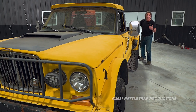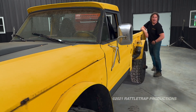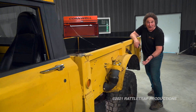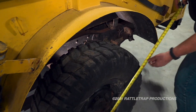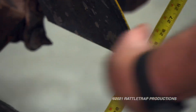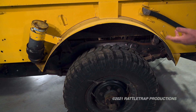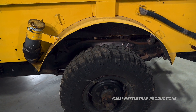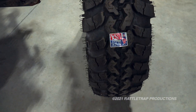The first thing you need to decide is what the goal is here — how do you want the new wheels and tires to fit? On this old crusty truck, we want to get rid of the old tall skinny look and go wider and taller to fill out these big huge radius fender wells. If you measure from the center of the axle to the tightest part on the fender, you can see that's roughly 24 inches. If we double that, that tells us that a 48-inch tall tire will fit in this wheel well with no clearance. Since we want clearance, we're going to drop down to a 41-inch tall tire — that's going to fit really nice and give us plenty of clearance. For tire width, we want something nice and fat, about 14 inches wide once it's all mounted up.